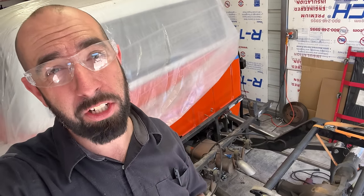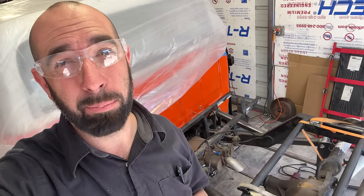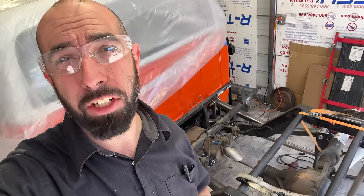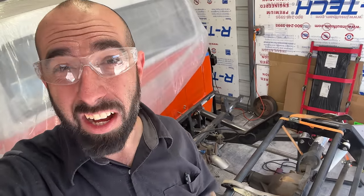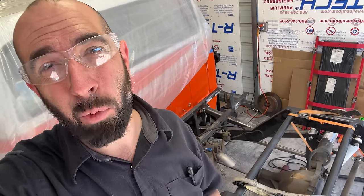And if you've been watching my channel, the why is pretty much the most important thing, but I just don't have the time for that. But I've got a video on the magic of the drive shaft and the importance of pinion angle. And when I do my wife's Mighty Max, I'll get a lot more in depth on why pinion angle matters. But on this one today, since I'm so short on time, I just gotta tell you that I'm going to match the pinion angle to the transmission output shaft angle.